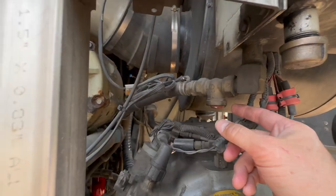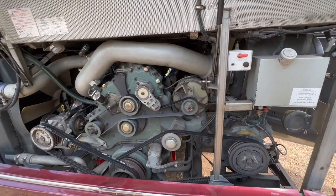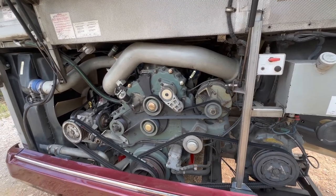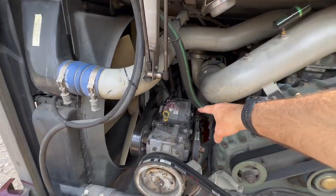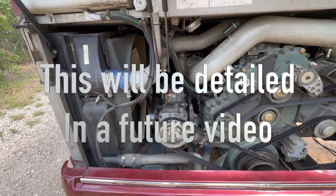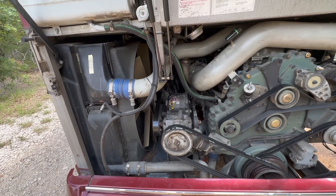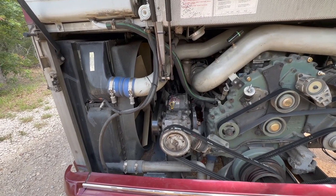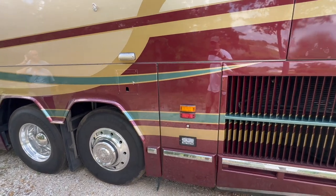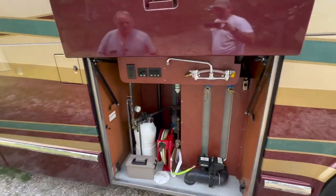This here is the oil fill, so you can see how much oil is in here. If you need a little bit of oil, you just flick this valve and you can fill up your engine. This is the Delco 50D — on this bus it's running all of the bus air. And on this one we've got the alternator back here. That's what we had to tap into — it had an internal regulator, so we had to pop that off and modify it. That's going to do as house batteries — it's a 175-amp, 24-volt alternator. Coming around the back side, this is the radiator, and then a bunch of controls and things for the electronic bay.